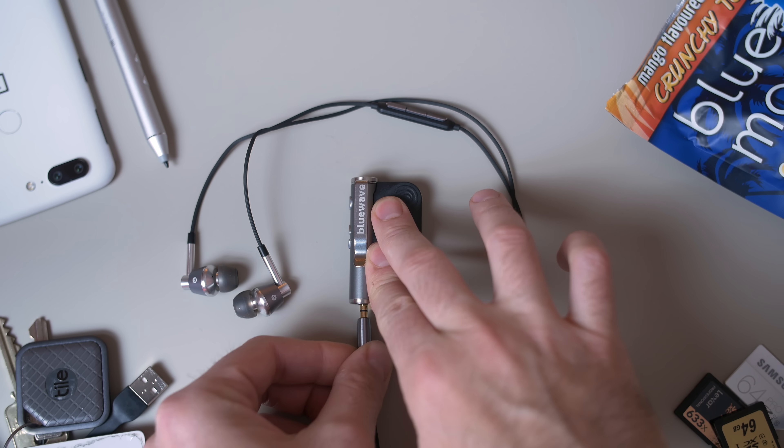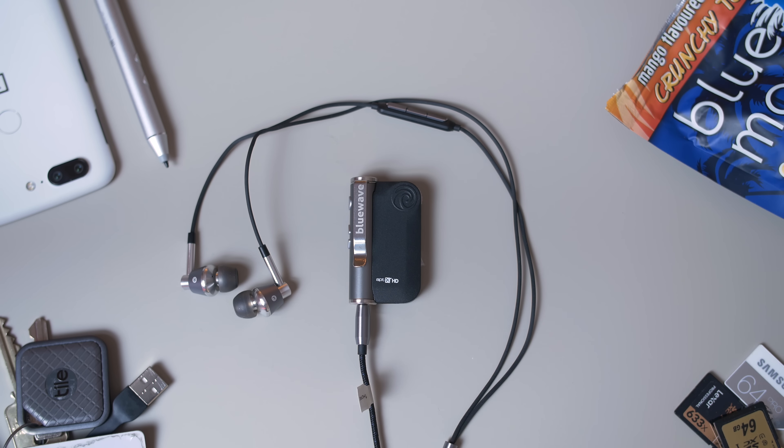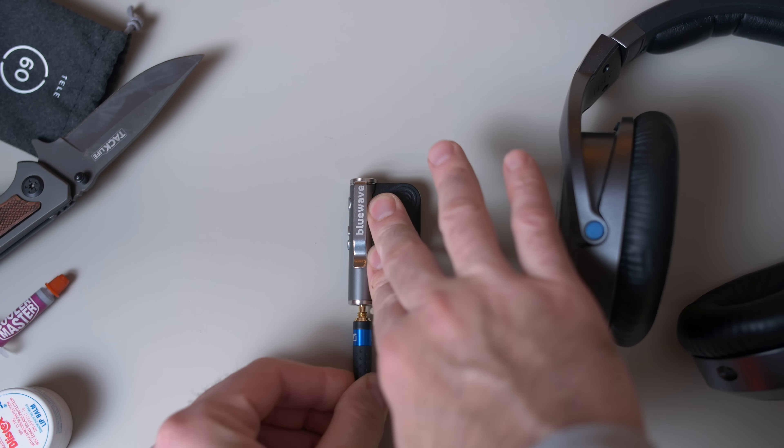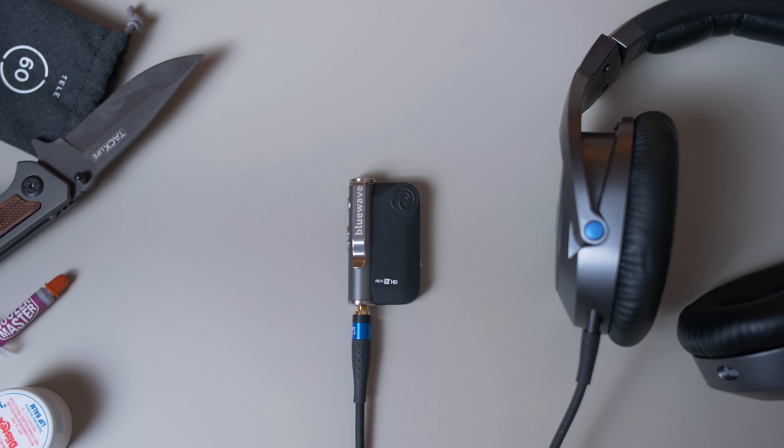When you use regular wired headphones or Apple earbuds, the sound quality is actually going to be better when directly connected to your smartphone, since you are using Bluetooth and the signal does get compressed — you will lose a little bit of sound quality. It's not a huge deal, it's very small but noticeable. But with headphones that require bigger drivers, the volume can only go so loud on a smartphone because the DAC is more limited. So overall, you can get better audio quality with wired headphones through this amplifier compared to wireless ones.